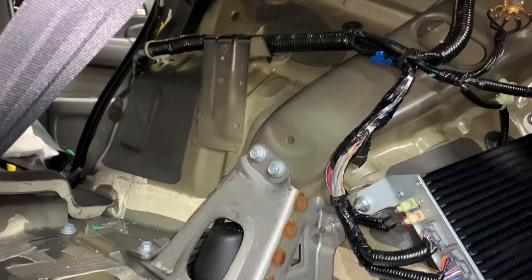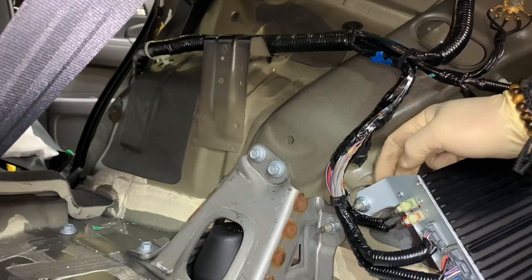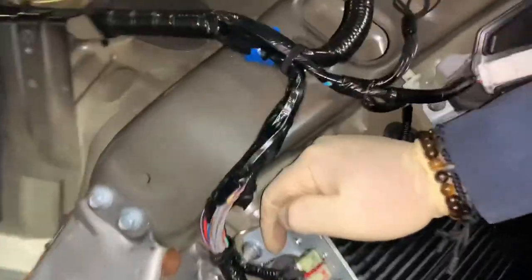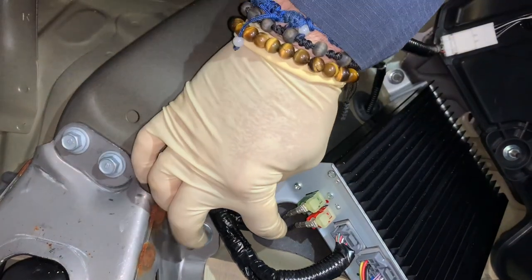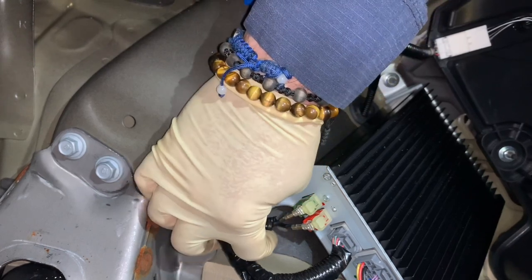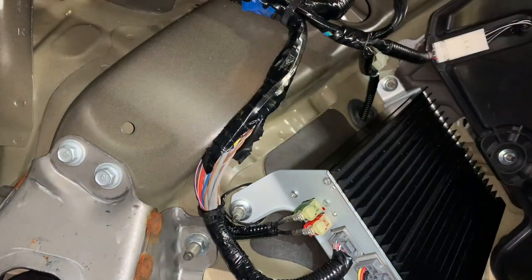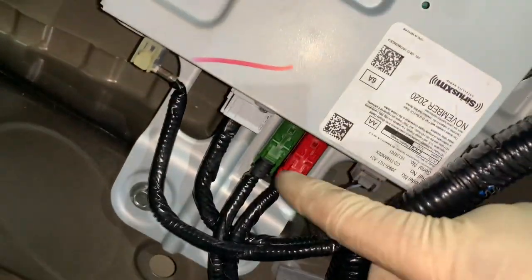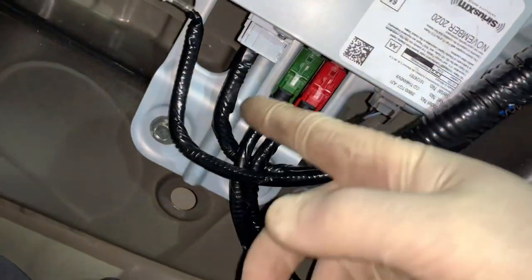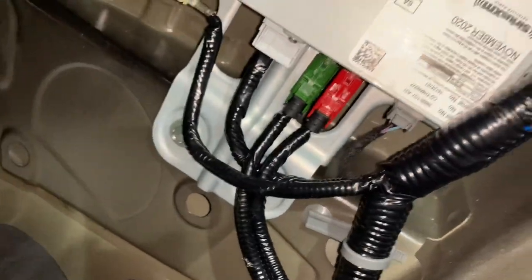Here we are — I've zip tied one around here, then looped up another one and supported it up against its own bracket right in there. We did eliminate the OEM zip tie, which obviously doesn't do a good job anyway. As you can see, they are a lot straighter now — you can still wiggle them a little bit and they're not really under tension. These have the updated connectors already and they look pretty good — I might tuck them underneath just to give it a little less of a bend.